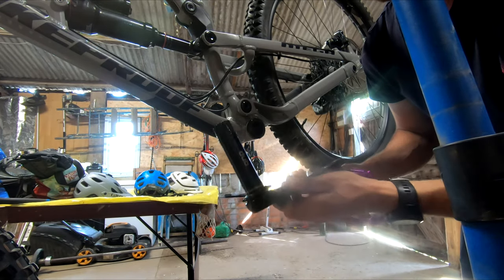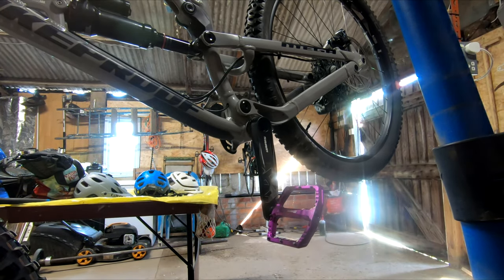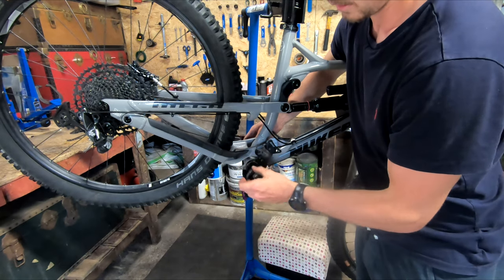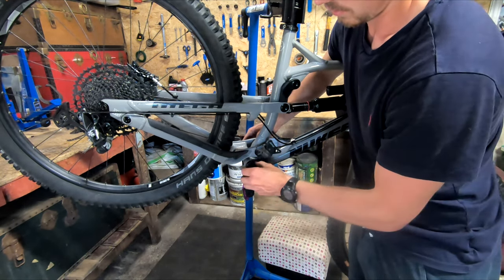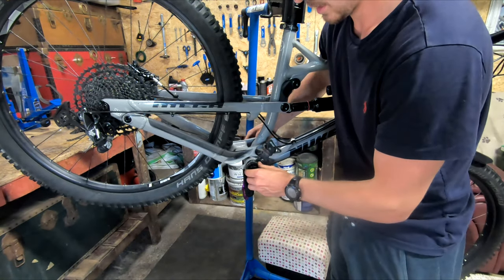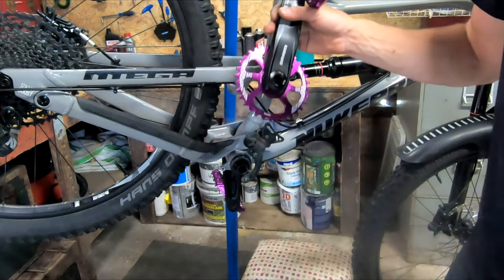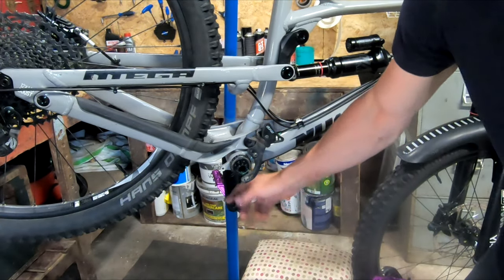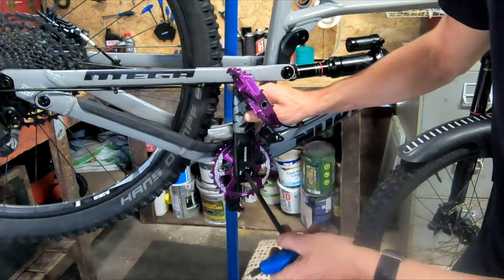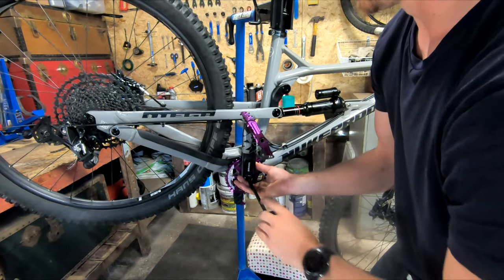All greased up - slide it in, give it a bang and it will locate itself right there. Now go around to the other side. Get the washer and put it back on - don't forget there is a certain way it needs to go on. There's a slight curve on the edge of it - make sure that goes to the bearing side, that pushes in there. Put the 8mm hex back on, obviously opposite to the crank on the other side. Just push it against there - it won't slide on until you start to screw it in. It's probably a bit of a two-man job but it's manageable on your own.